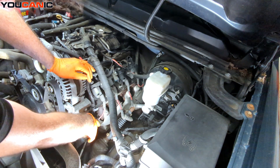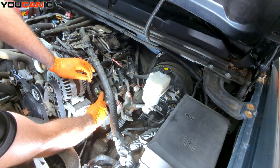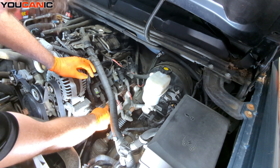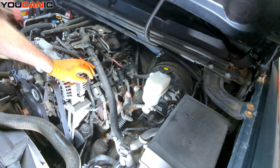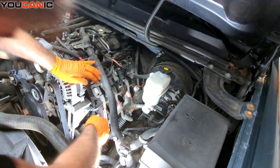We had success getting all these cables disconnected — they are still just dangling from the coil. We could also separate those if we feel we need to. Now let's see if we can remove the spark plug using our socket and ratchet. We may need an extension depending on the length needed. Make sure we're going counterclockwise.